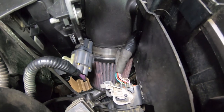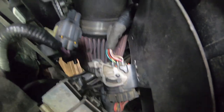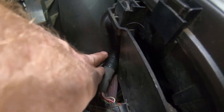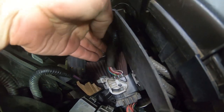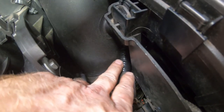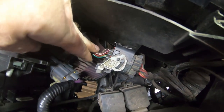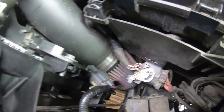Let's show you that our air intake tube, along with our filter, is reinstalled, and you can see it crammed down in the corner there. Now you may be looking at this wiring harness and saying, "Hey, that looks like it's pinched." It's not. There is free play in there between it and the fuse box here and the air intake tube. Now, to be fair, Procharger wants you to unhook it from here and push it up underneath the fuse box so it doesn't get in the way. I didn't want to do that. I just took some more wraps of electrical tape and wrapped it around this area as extra support and insulation. Like I said, it's been that way for 3 years and it's been fine. I didn't want to take this connector bundle off and push it underneath because there's nothing to attach it to, which means it would just sit there and dangle. So that's why I did what I did.